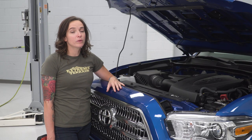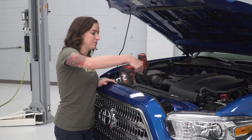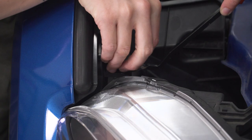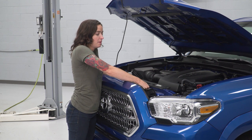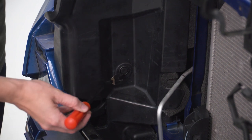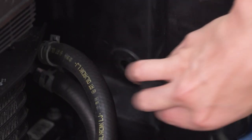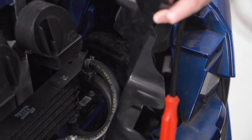This portion of the install is optional, but we're going to remove the grille to get a better look at where these brackets are going and to get to them a little easier. Grab a 10-millimeter socket and remove the two bolts out of the top of the grille. Next up, remove the two pop clips holding in your grille to your headlight. With all the hardware out of the grille, pull up on the two plastic brackets on the top and then pull the grille straight out. We're also going to remove these plastic air dams behind our grille. Remove the pop clip and you should be able to slide these out. Pulling straight out to release the clips, you should be able to twist it and remove it.